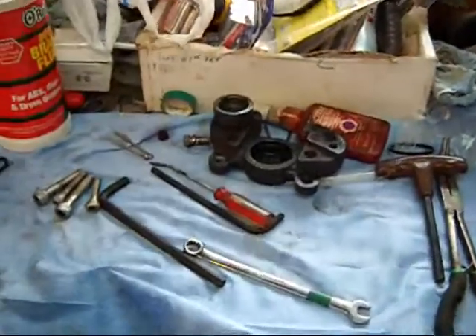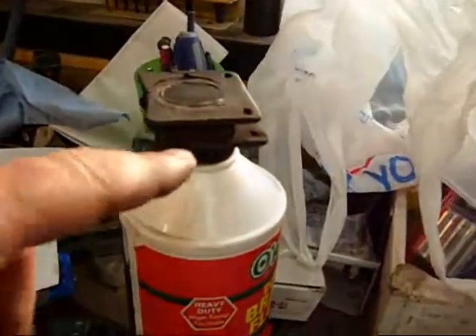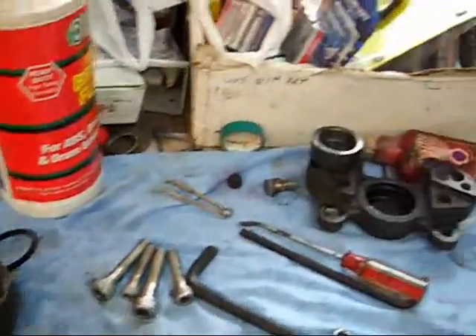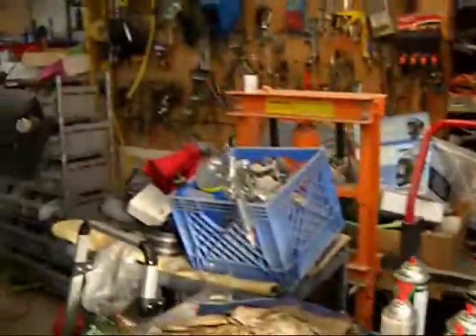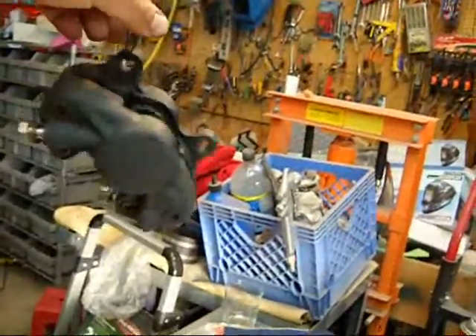Alright, rebuilding the calipers. I noticed that one of the brake shoes was actually wearing a little more than the other side, so I decided to go ahead and put a brake caliper kit on it. I'm in the process of cleaning it up, getting the bolts out, blowing it out with parts cleaner. Here's one that's finished on the other side — I just put a little high heat paint on it, let it dry, and I got some new brake pads.